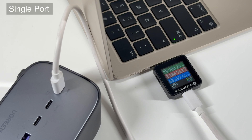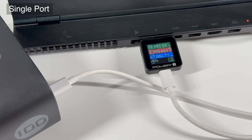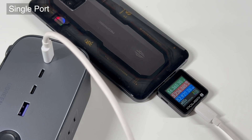Next, let's take a look at its charging compatibility. First, the USB-C1 port. Since it can support up to 100W PD, it can charge PD-compatible devices, and the charging power for some laptops can be around 90W. It can also fast charge some PPS devices, such as Red Magic and Black Shark smartphones. Since it can trigger 15V, the power can be above 50W.